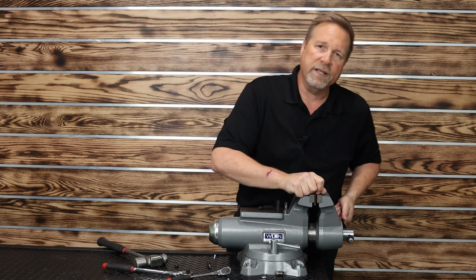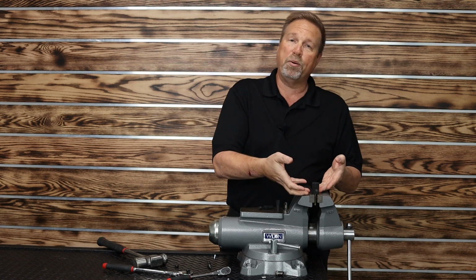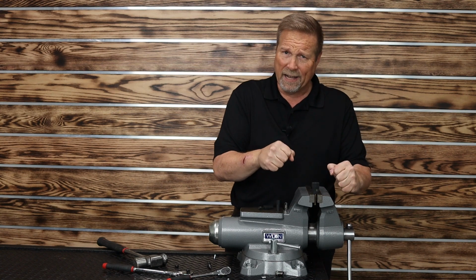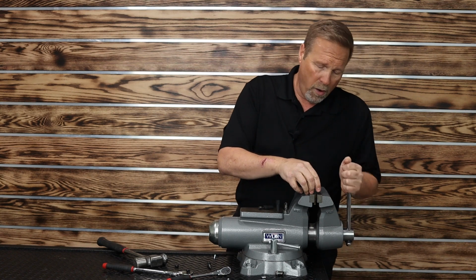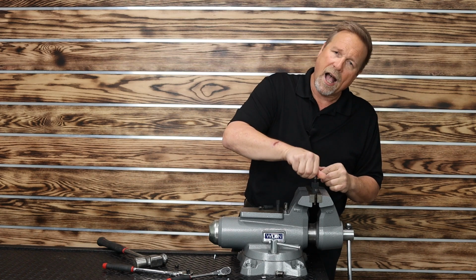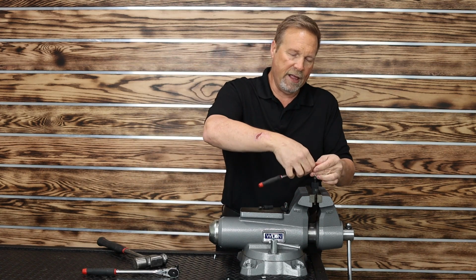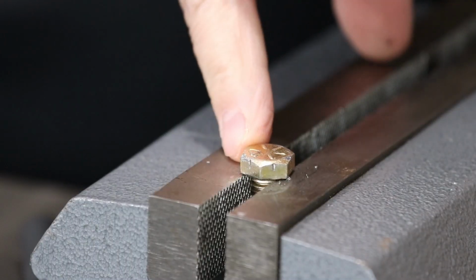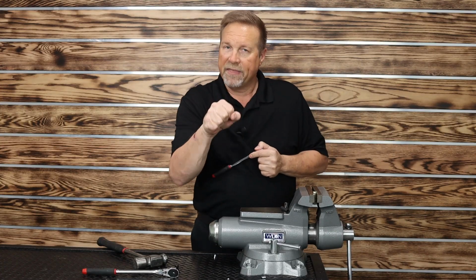So what I want to show you is that once you remove the bolt, we all know that forcing rod allows us to pull that, you know, we can put it back into the vehicle or the machinery we're working on, tighten it down, just snug as can be, pop it off with the forcing rod and go off about our day. What I want to show you real quick is that when the socket extractor bites down onto that bolt, on a good one, it doesn't damage the corners. It just makes a really nice little line down each flat. And that's how it grabs in.